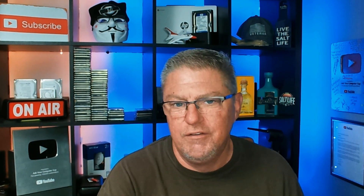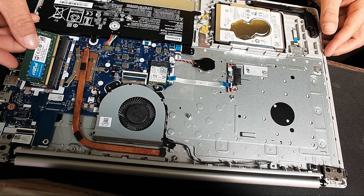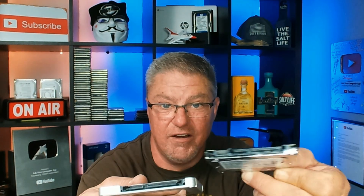In this video, I'm not going to go in depth about how to physically remove one drive and install it in another — there are plenty of YouTube videos on how to disassemble or swap your hard drive. Once you've taken them apart and confirmed they have the same drive type, you're good to go ahead and swap them. In this case, this is my bad hard drive. As you can see, they're both SSD drives, so it's an easy swap. Just pop the drive in, lock it down, and now you're ready to try to boot Windows.